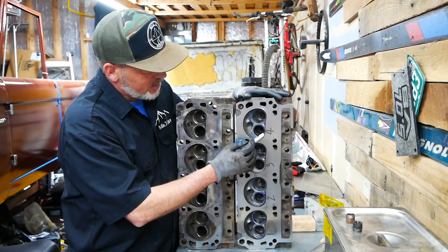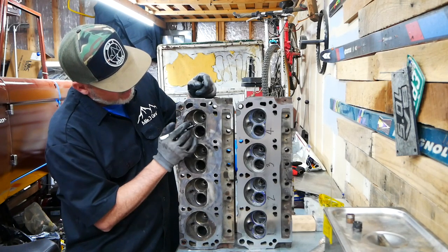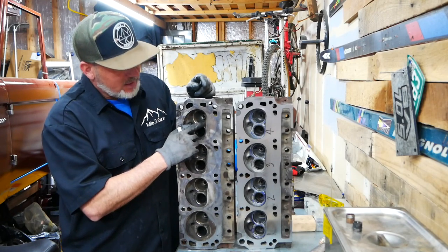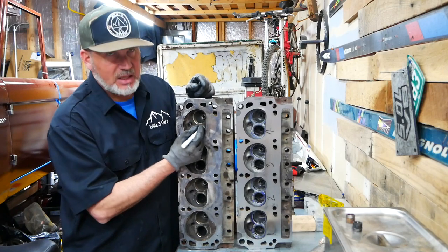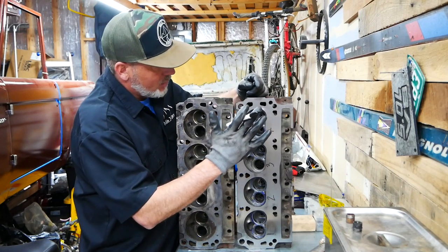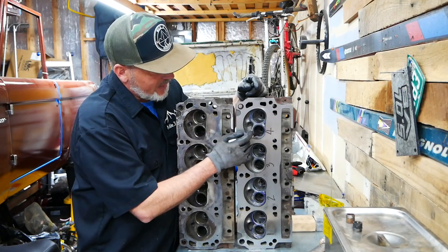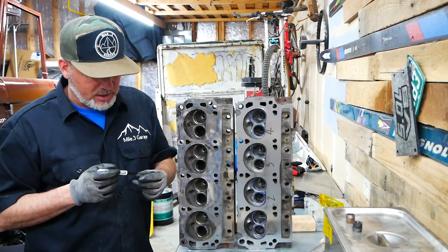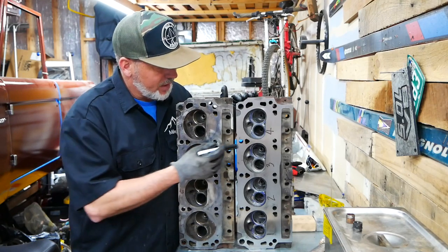The third thing I did was unshroud the valve. On the old heads there's a very sharp ledge right where, when the valve is seated, it actually shrouds the valve. I took a small Dremel and smoothed out that ledge so theoretically when the piston compresses and the exhaust valve opens, the air should move into the valve a little cleaner without turbulence. I had to do it very carefully as not to impact the actual mating surface of the valve — and I didn't touch it one time.